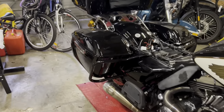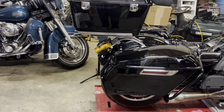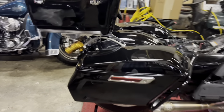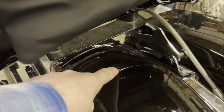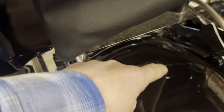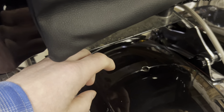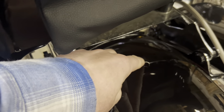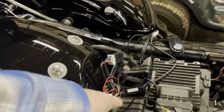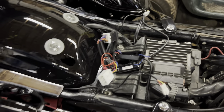In this video we're going to tackle adjusting our rear shocks — the preload and all that with the Öhlins suspension. I still have to install new brake pads. I also have to shave down a nut because I couldn't find a longer one that fits underneath the bottom, so I'm going to shave around the top. This is for our seat — the OEM sheet metal for the fender is thinner than the ABS plastic, so I need to shave it down until I can get the snap ring in. I also have to install two-sided tape and load resistor packs so my blinkers work.